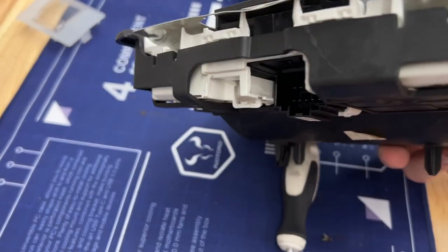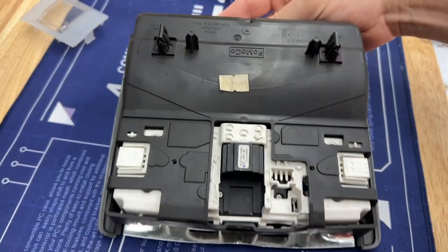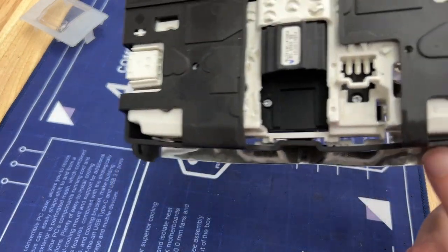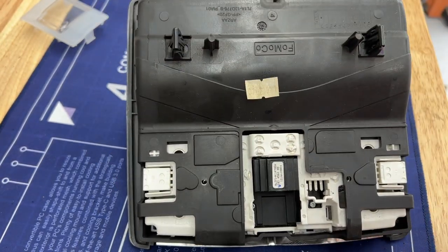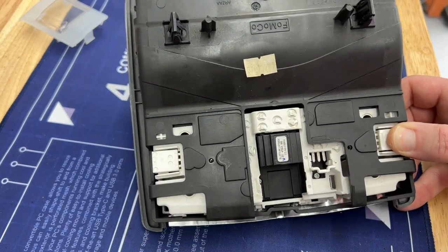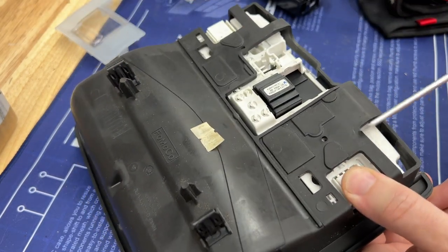Now the switch — still can't get to the switch until we take out the white piece. This whole white part inside the black casing. Now's a good time to replace the light bulbs if you need to. I'm going to flip it back over. There are four release tabs to get this white piece out. We're going to start with the ones at the front — there's one right here and one back here, but the front one is the easiest to reach for. This is a great little place to put your thumb to help push it down, so just kind of pull out — and that one is released.